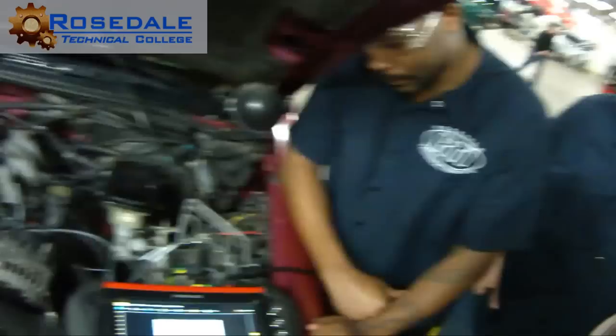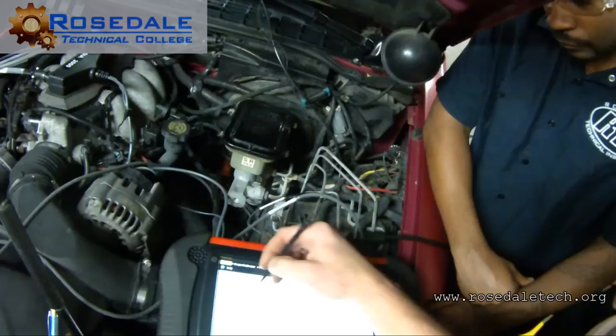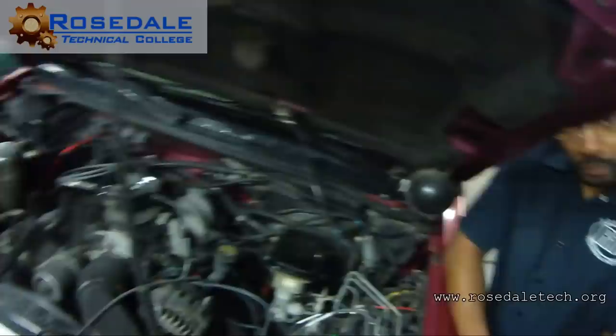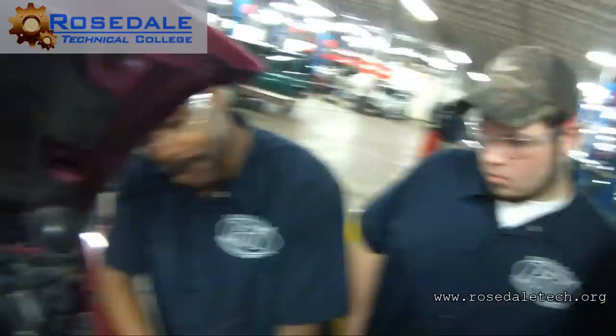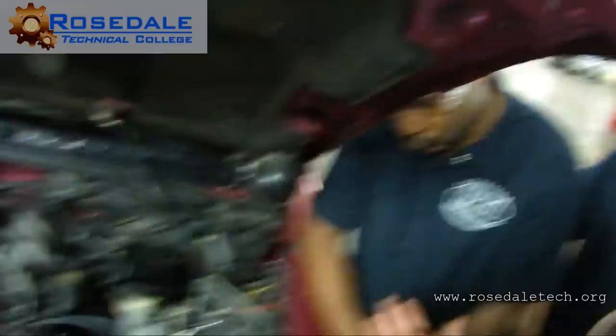And then what I want on my time base, wait a minute. Ignition scope. Hold on, I need to go back. You guys went in too far, I believe. Ignition scope. What did you pick from here? Somebody accidentally picked something. What I generally want is a parade. And when you think of a parade, you think about fire trucks going past in a row, you know, parade pattern. I want to see all the cylinders in a parade pattern across the screen horizontally. That would be parade. That's my favorite view of a secondary.